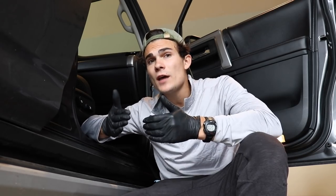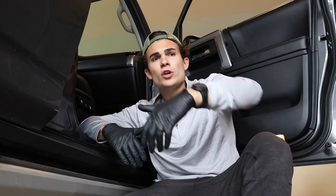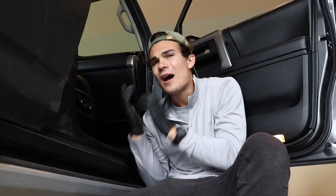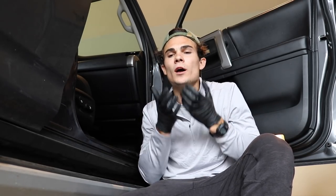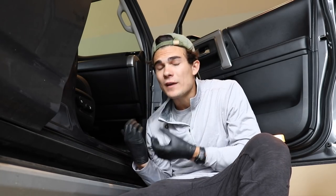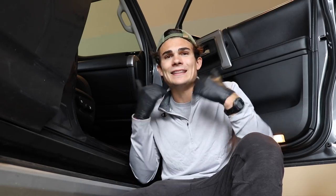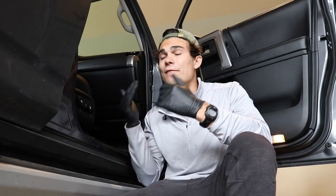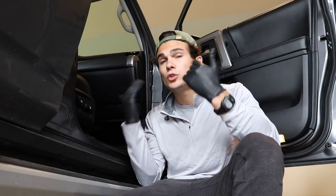Number two: one of the reasons I'm using a conservative amount of Super Clean degreaser is, yes, I don't need a lot because this is just not a very dirty job. But also, because I'm not hosing it off, I don't want to use a ton of degreaser — when you hose it off you really dilute and flush it all out. It's not that I'm not getting the Super Clean out, but just in case the steamer doesn't flush the door jamb out like a hose would, I don't want an excessive amount of degreaser left over, because degreaser can be a little hard on paint if left for a large amount of time. I'm using the steamer to agitate it and also to flush the degreaser out. This is a great example — I've used this strategy for a very long time, with clients where I have literally used it for two to three years, steaming and degreasing, and never had any problem with their door jamb. It's a very tried and true strategy.